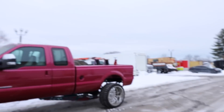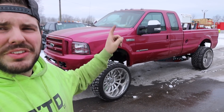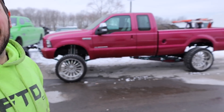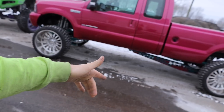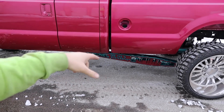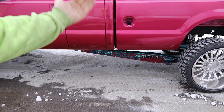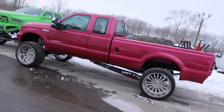I do have a TikTok, so follow me over there — I just posted a quick video of this thing. It honestly looks really, really good. A couple things are definitely missing, like a wiper. Driving it, there's some satisfaction to it — I can't wait to actually get it out, get the bumpers on, tail lights, all that stuff, and just finish it up. Also on the track bars, they do twist when I drive — that's because I'm completely new to heim joints. One needs to be one way and the other the other way, and then they'll fight each other and stay straight.